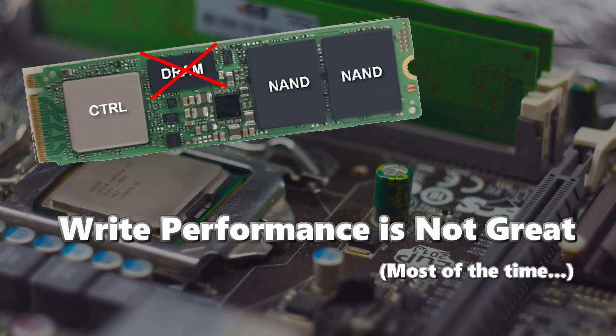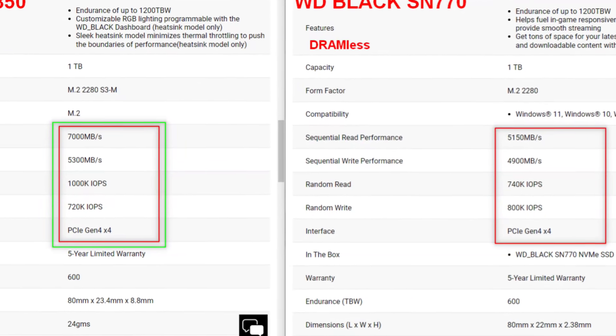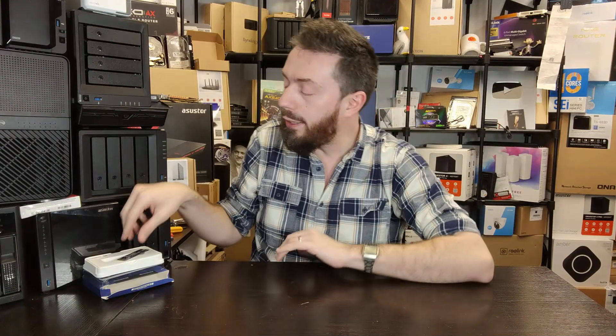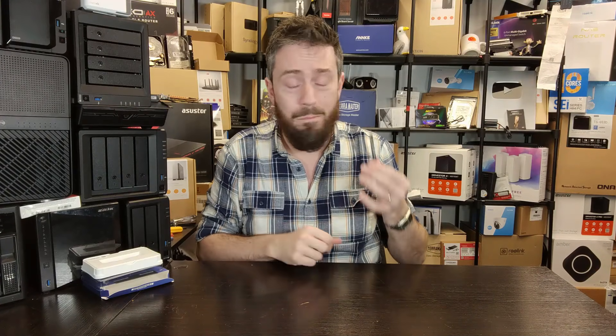But it's not all bright shiny news. Alongside those five good reasons, let's go through five reasons why DRAMless SSDs are simply not going to be right for you. Realistically, write performance on any DRAMless SSD is going to be substandard compared to any SSD with memory on board. You tend to find that DRAMless SSDs deliver sometimes two-thirds or even half the write performance of the exact same drive with DRAM on board. If write performance is important to you, give them a miss.